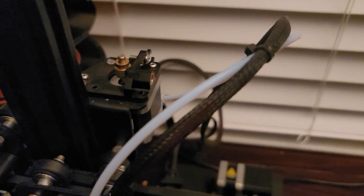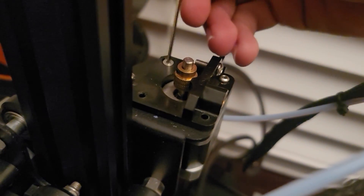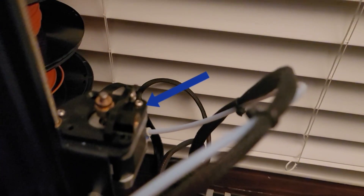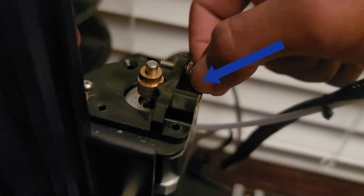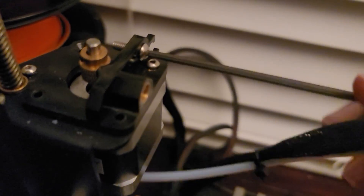After this, we're going to go to the back screws. This is the part where you actually have to be careful because all of these screws are connected to the motor. Now we'll take out the back left screw, and then the last screw in the corner. The only issue is there's another screw blocking it, preventing us from getting it out. So you have to get another size Allen key — the same one used for the longer screw — and just loosen and remove that blocking screw completely.